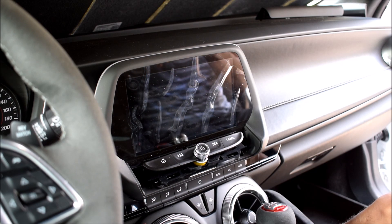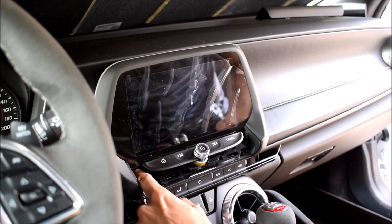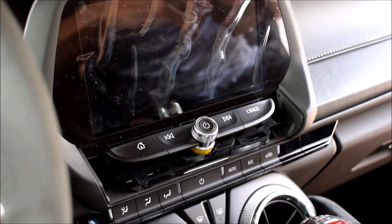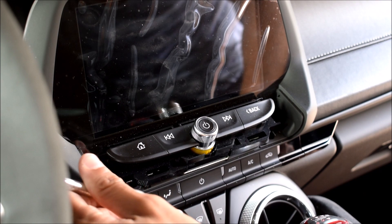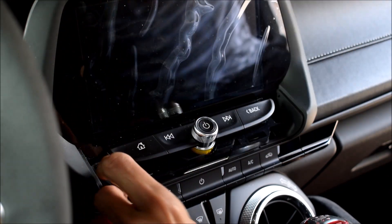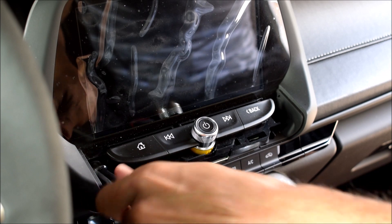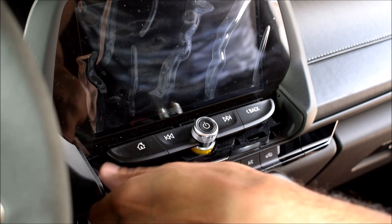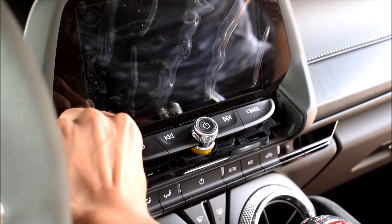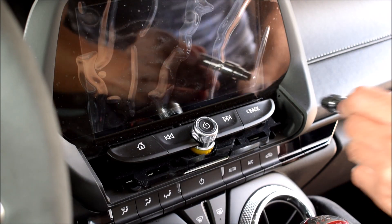Having done that, we need to remove a couple of the screws that are in there — they're size 7mm. There's one on this side, one on this side, in these kind of little pockets. Yes, my interior is quite dusty and in need of a clean. Got the first one here — these aren't on very tight, basically hand tight is what that felt like. I'm just putting these up on top of the dash or down on my WeatherTech mat so I don't lose them.